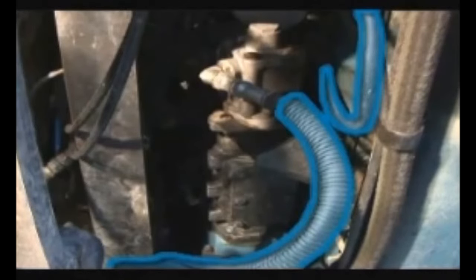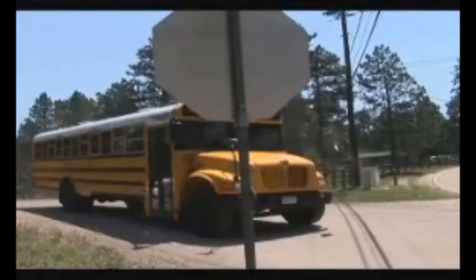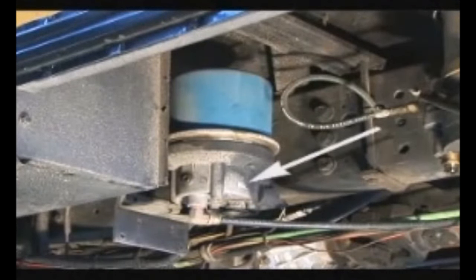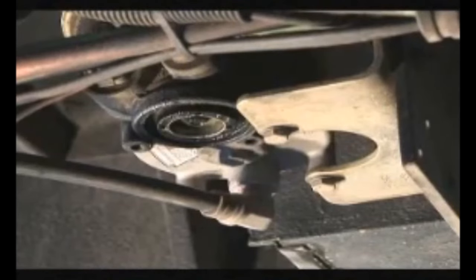This same thing happens on cool summer nights when moisture in the air is deposited as dew on the ground. But moisture can mean danger for air brakes — during cold weather it can freeze, block the airlines, and cause brake failure. Even in mild weather, moisture can cause corrosion that can clog airlines. Moisture collects at the bottom of the air dryer, where it is periodically vented from the system by a blast of air.